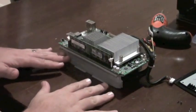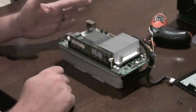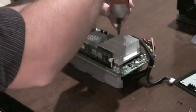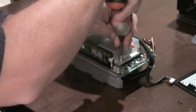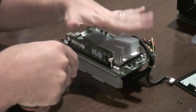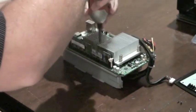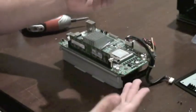Here we have the power supply underneath with power leads running over and on top — RAM, CPU, north and south bridge, all the connectors at the back, and this large connector here for the hard drive backplane. Underneath the heatsink is what we want to get at. There are four spring-loaded screws. I normally recommend undoing these in a diagonal pattern slowly so you don't rock the heatsink off balance too badly. You'll hear the screws make a clipping noise as they come off. That's the heatsink off.